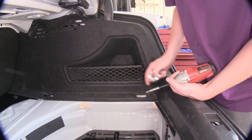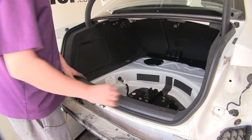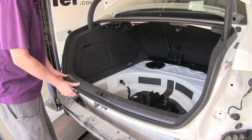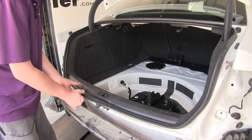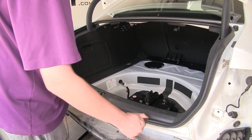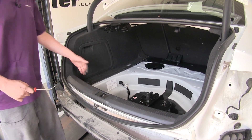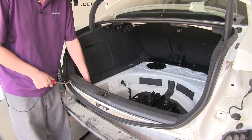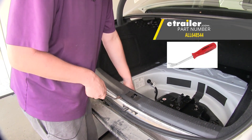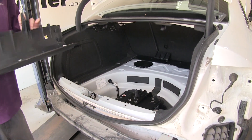We'll now repeat that for the remaining three buckles. Now we'll need to remove the trim panel located here at the back. The panel does just pull straight up, but to make it easier, I do recommend you peel back your weatherstripping here because it does kind of overlap it and it's already a really tight fit. Another benefit of pulling that back is that you can pull it from both ends — pull it from the bottom while also prying it in the front. Just work your way across and we can set that aside.